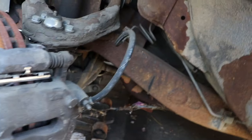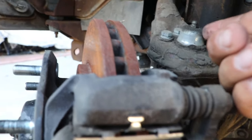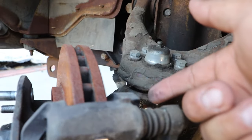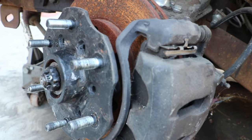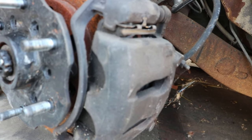But as you can see, we're working on Datsuns, and I'm working with a 78 Datsun 620. So I already have upper control arms, lower control arms, but with a ball joint. So when you have stock ball joints on your Datsun, no problem. Get the spindle, it's a drop spindle from Beltec. I don't know if you guys can see that, it's probably really zoomed in. But the drop spindle is a 2-inch drop spindle from Beltec. That works with the hard body brakes, no problem. Whether they're 4-wheel drive or 2-wheel drive, it still works.